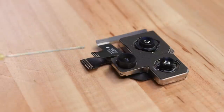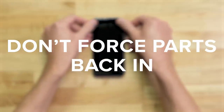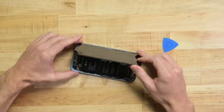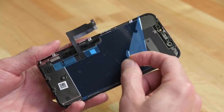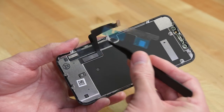Your fingerprints and skin oils can cause problems if they get in the wrong place, like inside a connector socket or on top of a sensor. But if you do touch something by mistake, don't panic — just clean it with a little isopropyl alcohol using a lint-free cloth or coffee filter and let it air dry. During reassembly, don't force anything. If something's not going together quite right, back off and investigate. Carefully inspect your replacement part, make sure it matches the part you're replacing, remove any temporary films or liners, check for obstructions, and then try again.